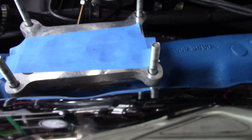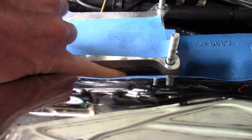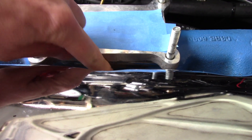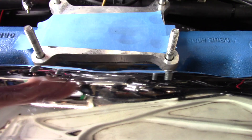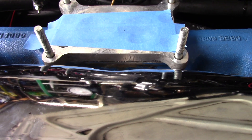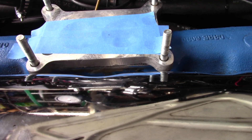So it's the next morning. The repair is complete. I put liquid high-temp 500-degree epoxy on this. It doesn't need to be that high a temperature where it is up top here, but I used it anyway just in case. Then I put some masking tape over it and let it cure overnight, and peeled it off this morning. The hole is filled. I'm debating whether to just run it and spray it, or pressure test it first. I think I'm just going to run it and spray it and see if we fixed the problem.